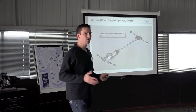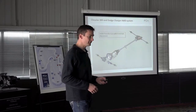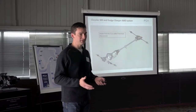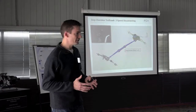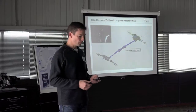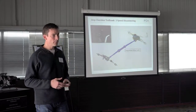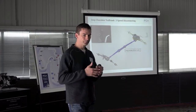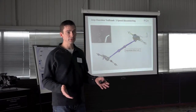Moving on to four-wheel drive systems, or four-by-four systems. We have front-drive-based and rear-drive-based. A four-by-four system that's front-drive-based is, as far as I'm concerned, unheard of and pretty much ruled by Jeep. First, the Jeep Cherokee — there are three systems available. Active Drive 1 utilizes the PTU with the disconnect and a wet clutch in the RDM, giving you completely capable on-road performance with the ability to disconnect for optimal fuel efficiency.